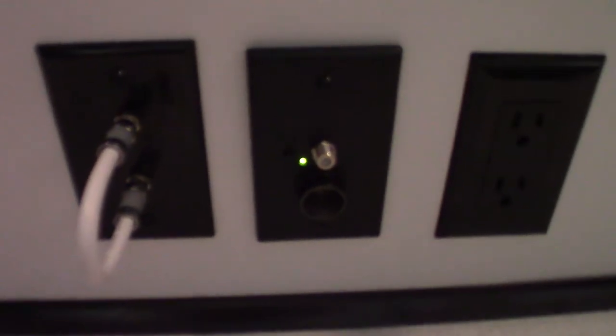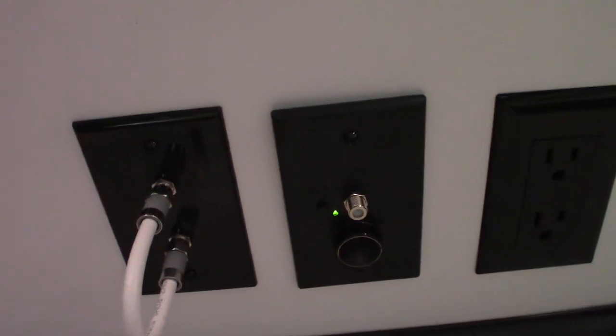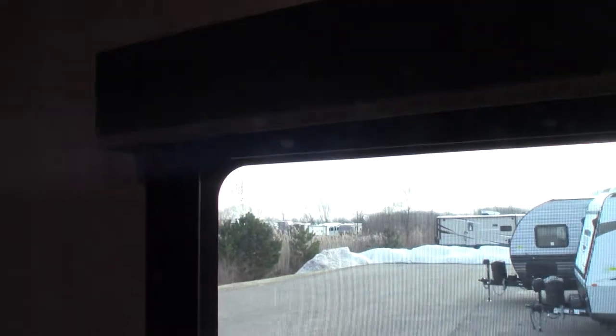More TV hookups here. There's a green LED with a little button next to it — you can turn it on and off, but you always want it on when using the antenna; otherwise you won't get a good signal. This is pre-wired for a Wi-Fi signal booster, and you can also get 4G on this model. If you add cellular, you'd pay a monthly fee through your provider. Most people just add the signal booster for Wi-Fi, get an antenna on the roof, and add a router inside.